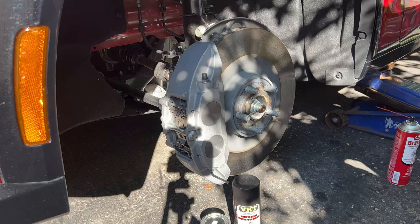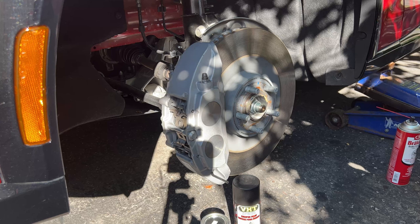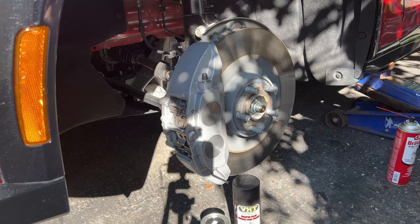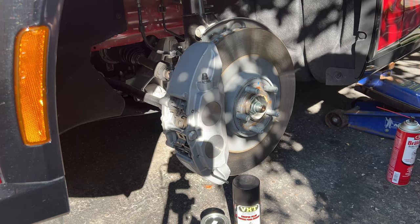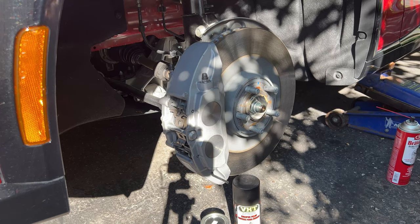They need something that will bring this vehicle to a stop and perform. With regenerative braking, you're not using these brakes nearly as much. I think the Brembo brakes, because they're a floating caliper with brake pads that slide in and more robust sliding pins, are made for a performance vehicle. They said 'we know it works, it's tried and true, let's throw it on' — but we're not going to advertise that it's Brembo. That's my rationale — could be totally wrong — but it's been proven on forums.